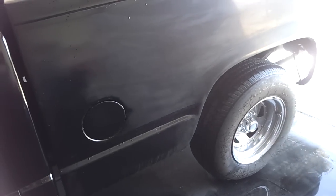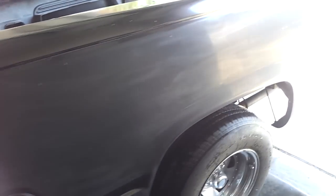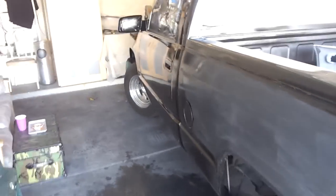I was actually working on the bed of the truck today. Got the second base coat on that already finished, so I went back over with 1000 grit, and this is the second rundown with 1500. I haven't quite done the top yet. You can see how the orange peel was on the top there. Let's see if I can block some of this light. Alright, but I'm sure it looks kind of dull.